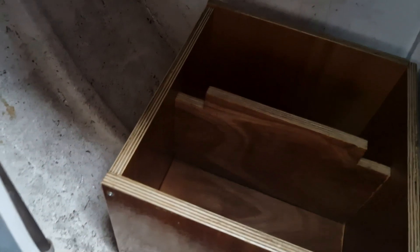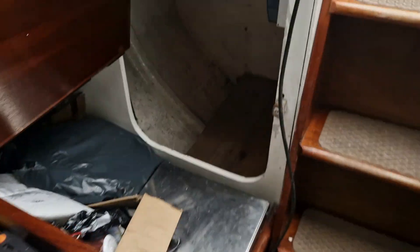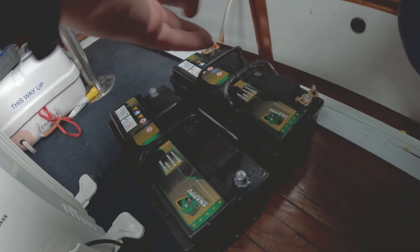I've just positioned these braces on either side because the box isn't actually wide enough, and I've cut these timbers out. So that's the bed for the box and that will now fit in there. That's in position — I've just got that set so I can withdraw the batteries out. It's nicely set up right next to the switch panel where the master switches are. Before I screw that down, I'm going to put the batteries in and check the cabling routing just to make sure there are no major issues.